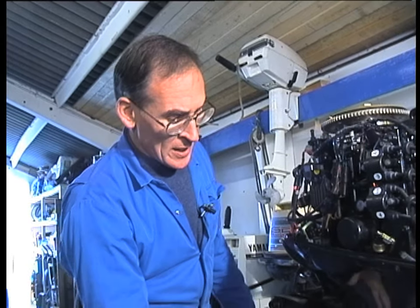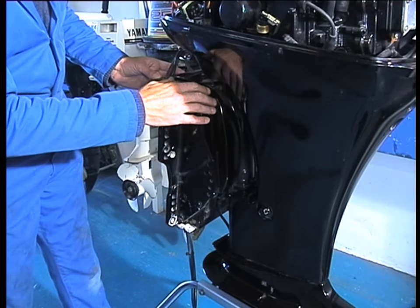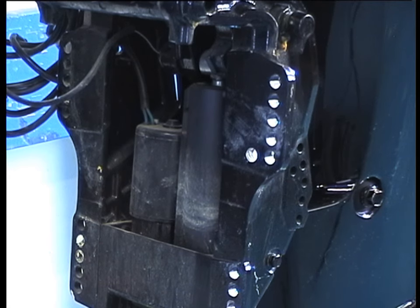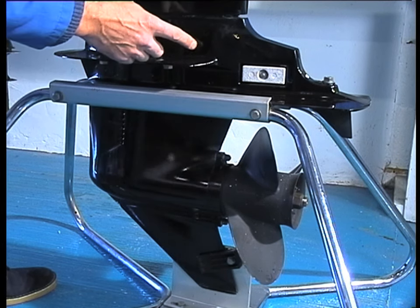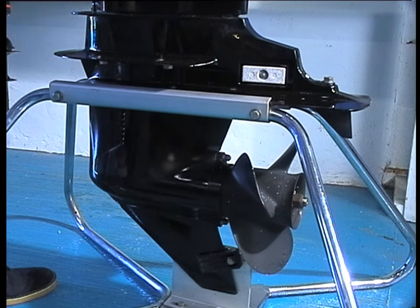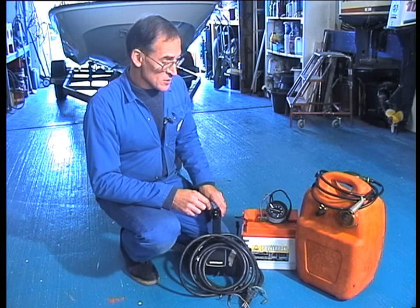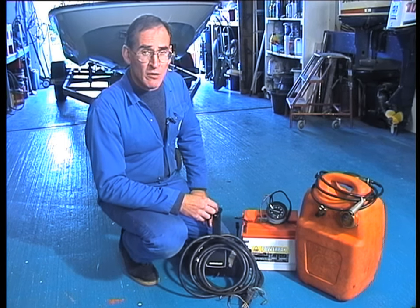The crank cases are mounted on the next component, which is the leg section. The leg section consists of an exhaust pipe, a saddle assembly which bolts the engine to the boat, and within this saddle assembly is a power trim mechanism to enable the engine to be lifted up and down hydraulically. The third component is the gear case, which contains a 90-degree transmission, a water pump mounted at the top of the housing, and of course the propeller, which gives you all your drive. The fourth component is made up of a collection of external services: a fuel system, instrumentation, a battery and controls. Bear in mind, an outboard has no superfluous parts — an engine can be severely compromised by the failure of the smallest bit.